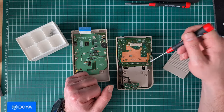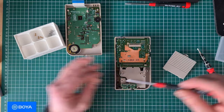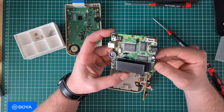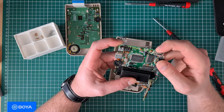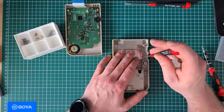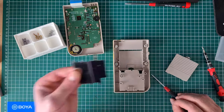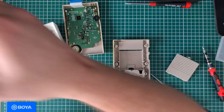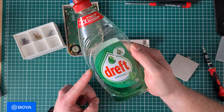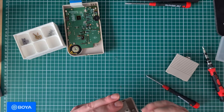To remove the back half of the motherboard there are four Phillips head screws. The back half of the motherboard looks to be in really good condition — just needs some cleaning and then it will be fine. The cartridge slider is attached with four screws. Everything can go into a pot of soapy water. You can use a degreaser or dish soap. Don't forget to remove the battery contacts from the back half of the case.